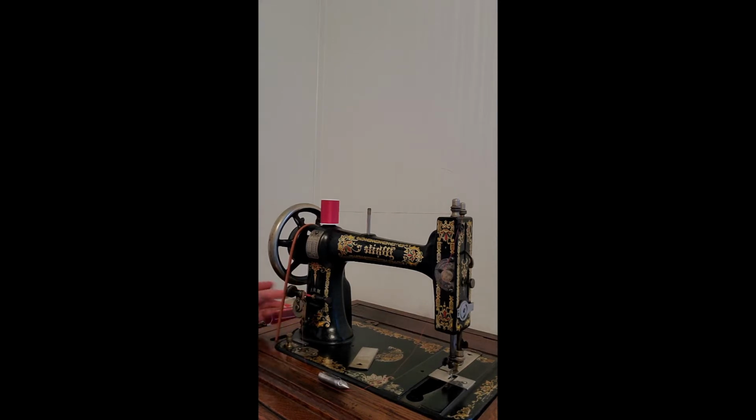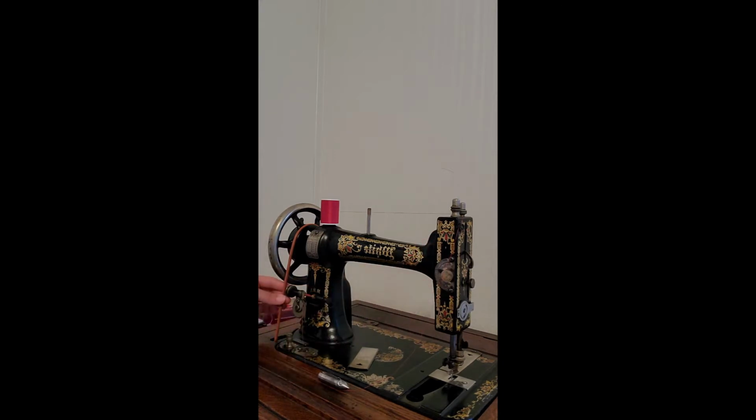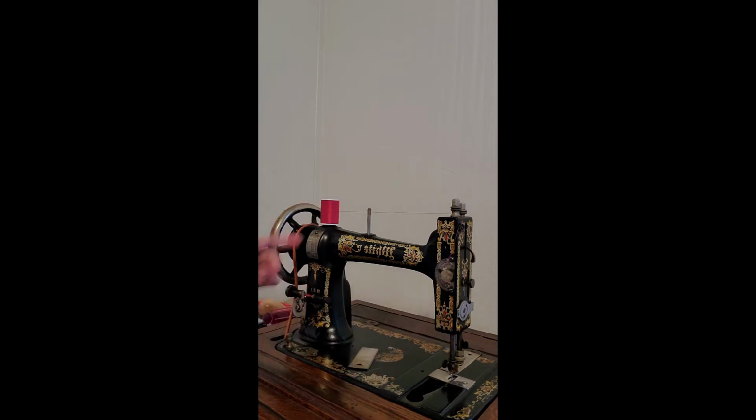this is the bobbin winder unengaged. You can see the belt isn't attached to anything there. It'll just move freely and run nothing but this part. But you push that back, lock it into place with the wheelie bit here. Make sure it is spinning the right direction and connected. It just locked into place, so it'll spin the way it's supposed to. I think we're doing good.